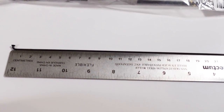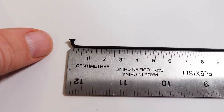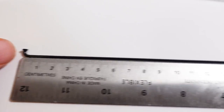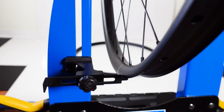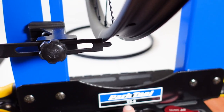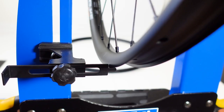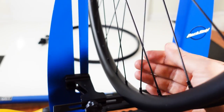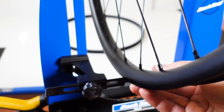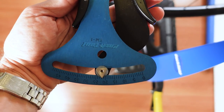Also make sure the spokes you bought are the same length. In my bunch of 294 mm spokes I found one that was 296 mm. The way you measure spokes is from the inside of the elbow all the way to the tip. You don't really need a truing stand — for my first wheel sets I used the bike upside down; at some point I bought this cheap Park Tool stand. Keep in mind you always have more time than any wheel builder out there, so take your time and do it right. Equal spoke tension on each side is way more important than a perfectly true wheel. In my case I have about 10% variation between the tension on the spokes on each side.